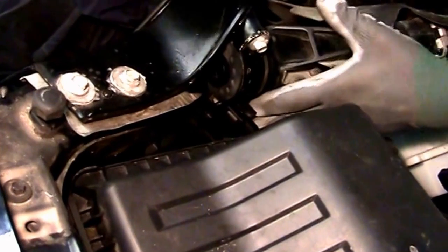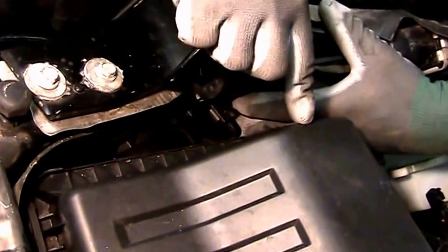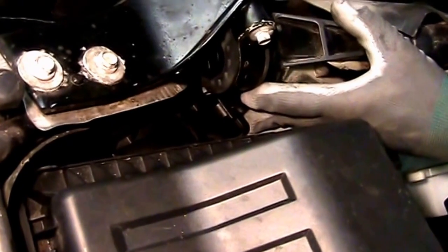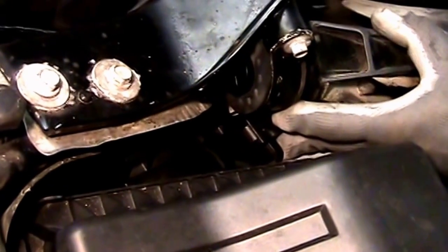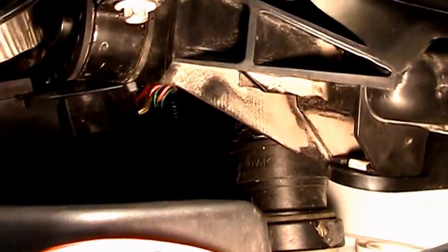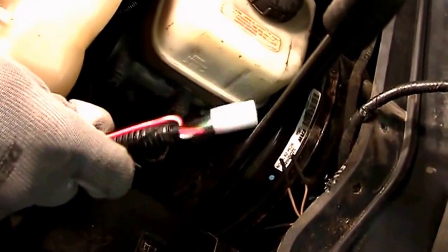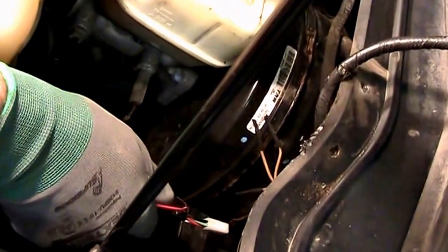On this model of vehicle, we found the best location is in front of the air filter. We will have to secure it in place using zip ties. After installing the module, you are going to run your control harness up through the middle and feed it into the firewall. You can run the control harness into the firewall into the cab.